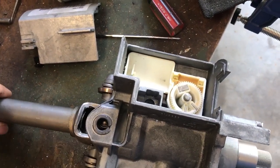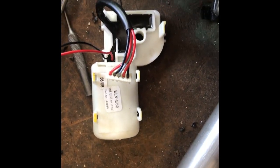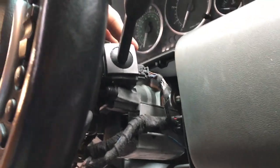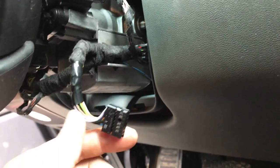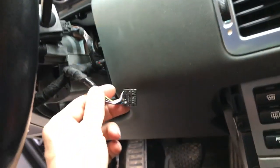I'm going to desolder this so the motor doesn't work, put the motor back in here, which will keep this locked in the open position. Then I'm going to put it all back together and see what happens. If the problem is that this motor has burned out so it actually won't release the lock, then I'm wagering my sensor is correct, my computer module is correct — everything else is correct. Other than deactivating the steering column lock, the Range Rover will work just fine. When putting this motor back in, make sure that tab right here is nestled properly, otherwise the case won't go on and the sensor won't make good contact. I had the motor upside down — don't do that.